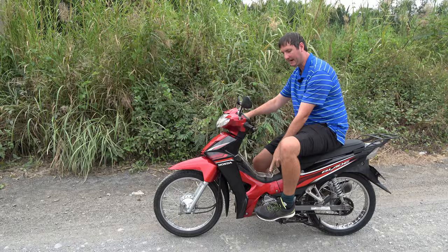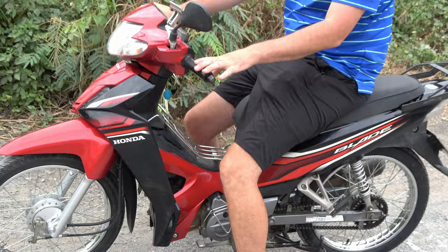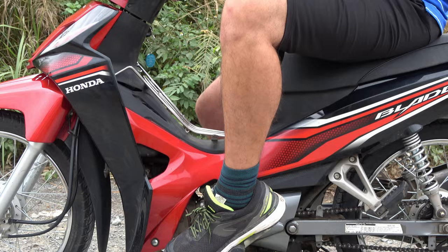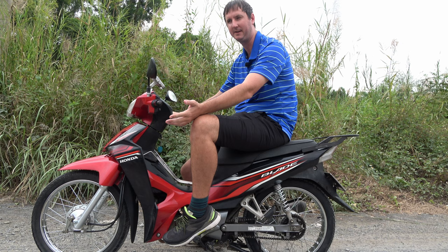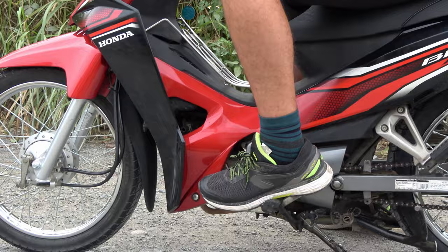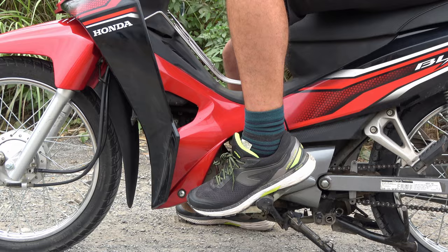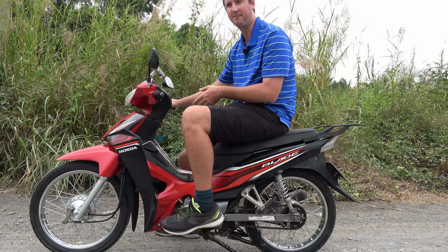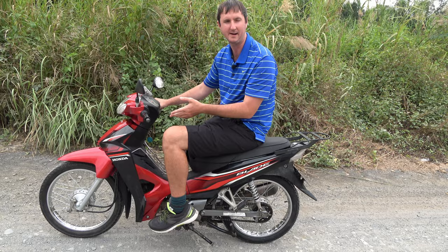To change gears: gear one, gear two, gear three — I'm in gear three now and I can still drive. So if there's no clutch, how do you burn it? If you half-click the gear pedal, it's the same as half pulling in on a manual motorbike — you're half-engaging the clutch, the discs are spinning, and they'll wear out. In gear two the bike moves forward, but if I half-press the pedal the bike doesn't move yet the clutch is still slightly engaged, and that will burn it.